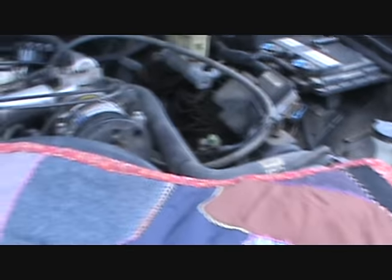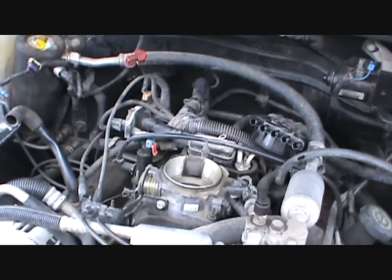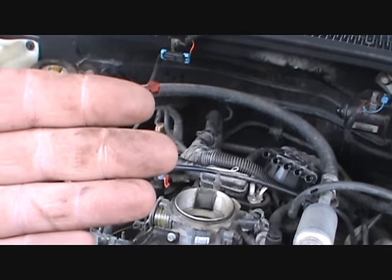Same size, so all right, we'll get out here. I'm trying to think too, because I was turning the distributor cap all this way and it was up against the intake and I couldn't get it down, the timing, so that means I got to move that tooth ahead. Okay, that did not make sense on how I had to set the timing. I had to pull the distributor out, went forward with it, thinking I had to go that way, but it wasn't really.